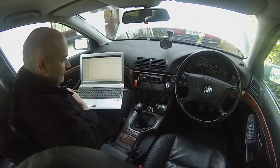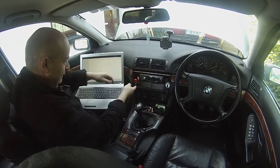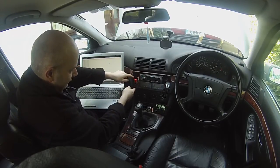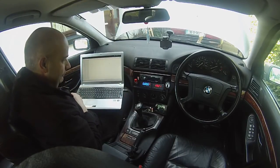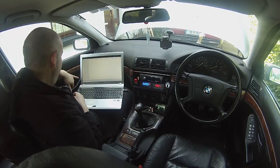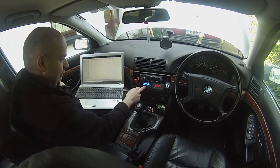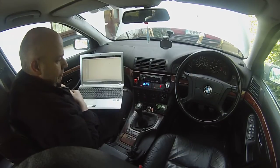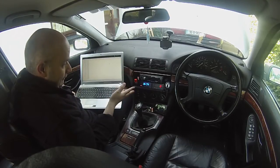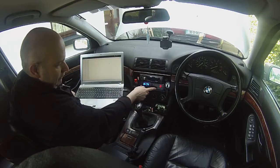So what this does, when we release our safety cover, and I've just got it epoxied in here at the minute, so the epoxy is still a little bit soft, but when we throw that switch, immediately the JLD 505 sees the pack voltage, which it starts to display here for me. And we see our other two JLD 404 meters come up. They're also displaying pack parameters, voltage in blue here and current in red.